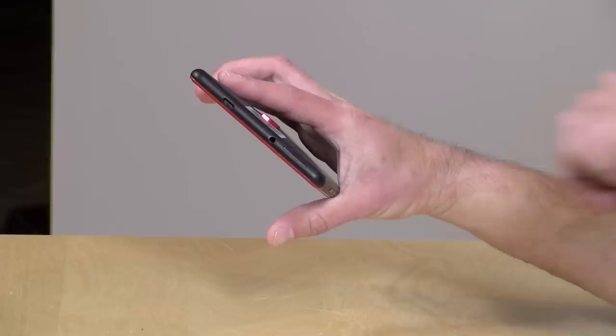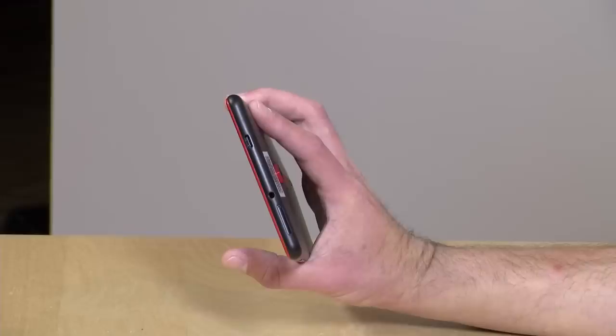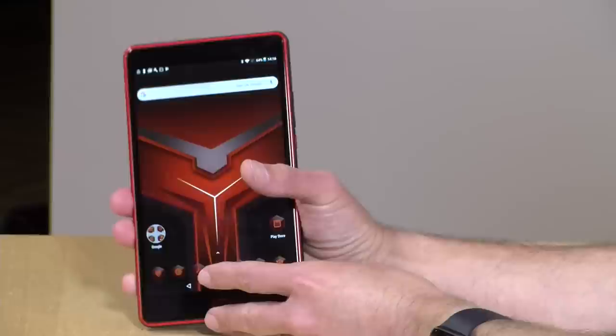The SIM card tray is up top and you can also put a micro SD card in there as well — it will support up to 128 gigabytes of expanded storage. There's a headphone/microphone jack and a USB Type-C port for charging. Note that it doesn't support USB-C fast chargers — I plugged in my MacBook charger and a few other phone chargers and those didn't charge it at all. Just the standard 5-volt 2-amp tablet adapter worked, and they do give you one in the box. The USB-C port also does not support display output, and it pretty much functions like the micro USB ports we've seen on older tablets.